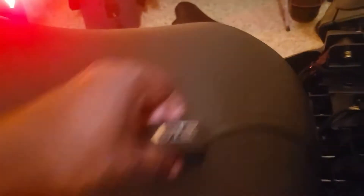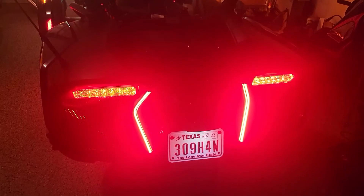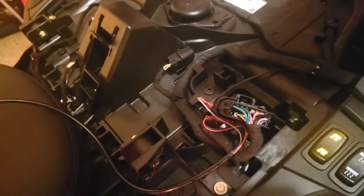If I flip the box right-side up — you can see now the brake light is on but steady, not blinking anymore. It works. The most important thing is this wiring harness: tap into the orange (12V power), the black (ground), and the white (brake signal/control). So the installation is confirmed functional.